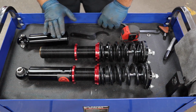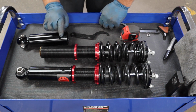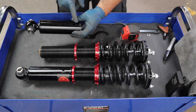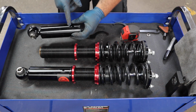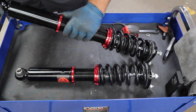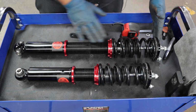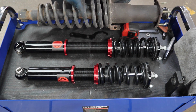Now, the rear naturally is gonna be a little bit higher than the front on my car because I don't have those RCAs. So I'm just totally guessing here, and I'm gonna go an inch past this. So about 2 inches of thread engagement on here to start out. This is just very ballpark, but we're gonna leave it about there. And the reason I'm guesstimating this, the reason this is so long, look at just how long the factory one is. It's a very long setup.